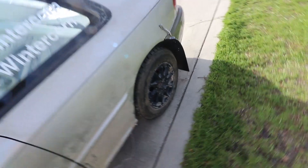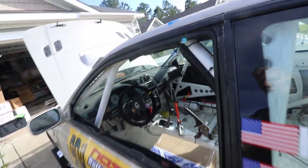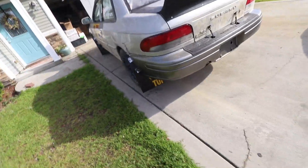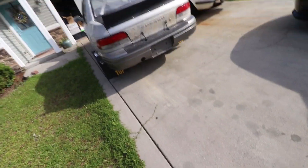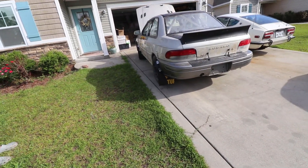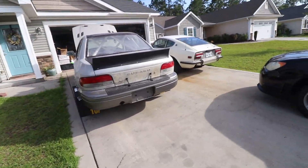Well, here she is. Still have some air in the brake lines so we're going to have to re-bleed the brakes - probably didn't do a good enough job, or the master cylinder leaks, or one of the fittings isn't tight and has a leak. Doesn't look too bad. I definitely could have lowered the mud flaps quite a bit and then you would have actually been able to see them more. I think it looks pretty good though. Whenever I need to replace these I'll lower them a couple inches so you can actually see the arrows - or just go to normal rubber.